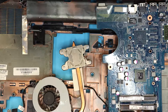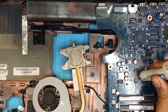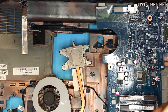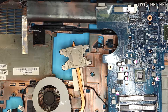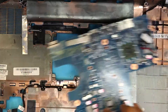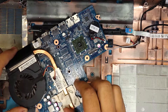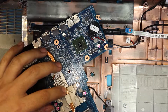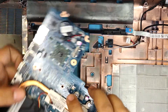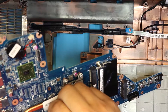Now we're going to apply Arctic Silver thermal paste right on the CPU. You can apply a little bit or a bit more — it doesn't matter. It's not conductive so it won't harm anything. Then put the heatsink on top and put in the four screws. Make sure you plug the fan cable into the fan connector — most people always forget that.